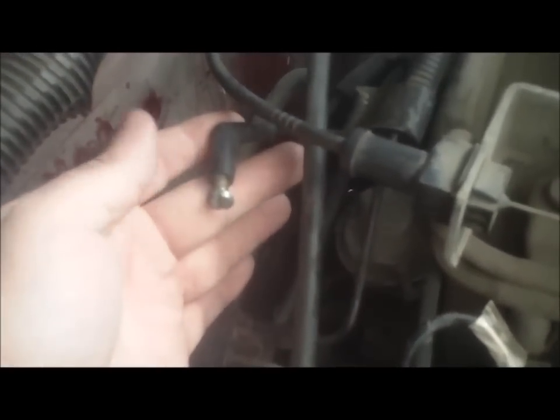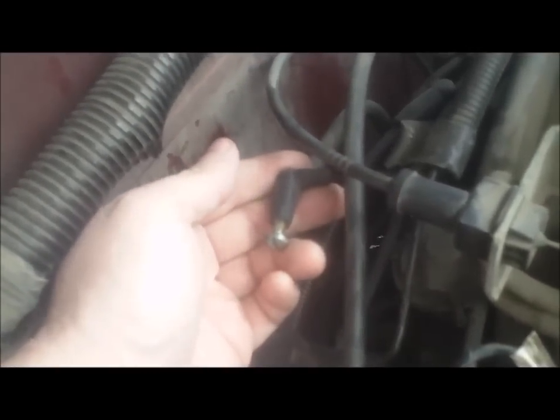The way I found it, the person that had the truck before me kind of jury-rigged it, because I'm actually missing the solenoid. They just took out the whole solenoid, bypassed it, plugged this vacuum line, and plugged the other line down here. Notice it's got a little screw in it — the two lines coming off the actual EGR valve are plugged, and the vacuum line back to the source is plugged. They just jury-rigged it, which is why I have the code.